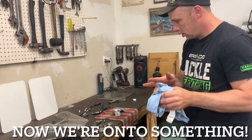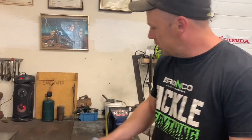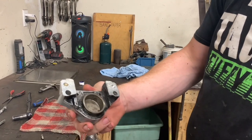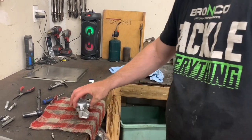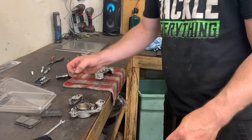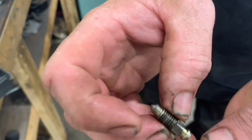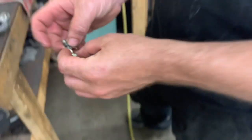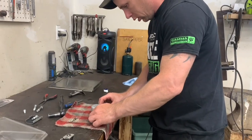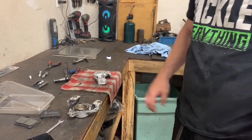I leave for a second to go get some screws, and I come back and the welder's on. And what are we up to? The plan is I'm going to screw this down to the bench just to block off them holes somewhat, and just to separate the two. It's going to be one at a time. I'm going to take the old bleeder because I got new ones with the kit. I'm going to try and weld this like so that the bleeder's a grease nipple. Hopefully just be able to pump it out with the grease gun. I've done it lots of times. The calipers aren't double sided like this, and it's much easier.